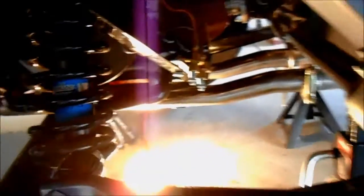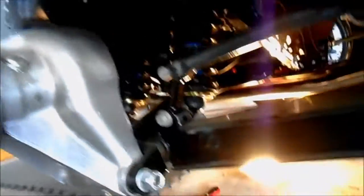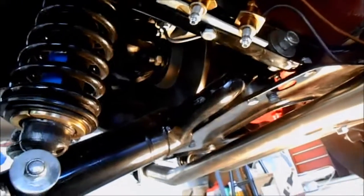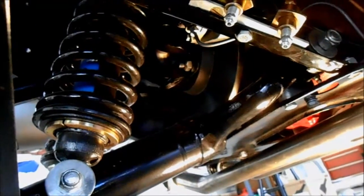Here's a shot of my remote rear brake bleeders. The brakes on the E-Type in the back are all the way up inside the suspension — the brake rotors are right next to the pumpkin — and getting to the calipers to bleed them is one hellacious project. So I put some little extension pipes on and clamped them down here where I can get at them. Take the wheel off and I can get both sides bled in a heartbeat.